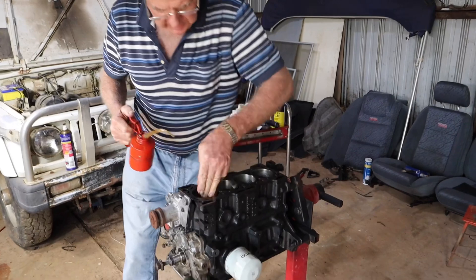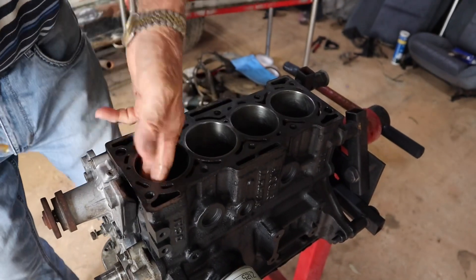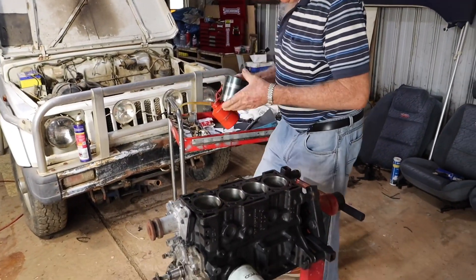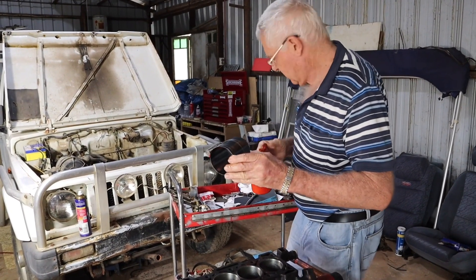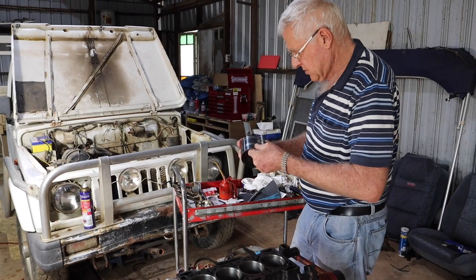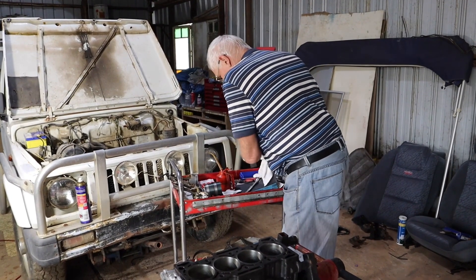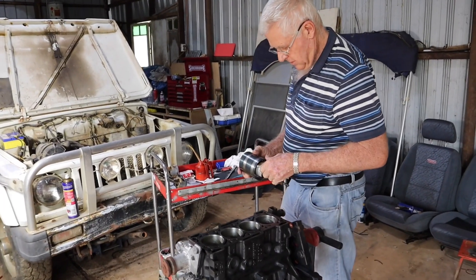A clean hand is going to oil the bore. Got to put my hands down at the bore — plenty of oil down there, and a bit up around on the chamfer. Come over here to the ring compressor — plenty of oil on it. This one's a type that has a clutch on it. I have used ratchet-type ones before; the clutch part is right here. That's got plenty of oil on everything. The ratchet type ones were thinner — this one seems to be thicker.